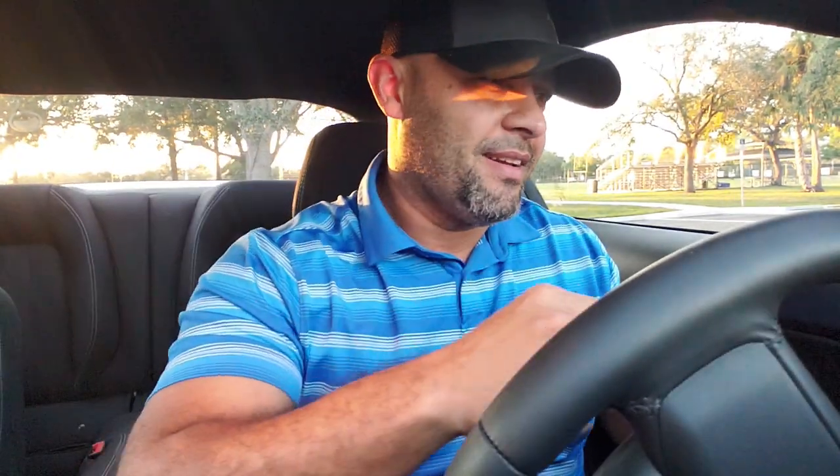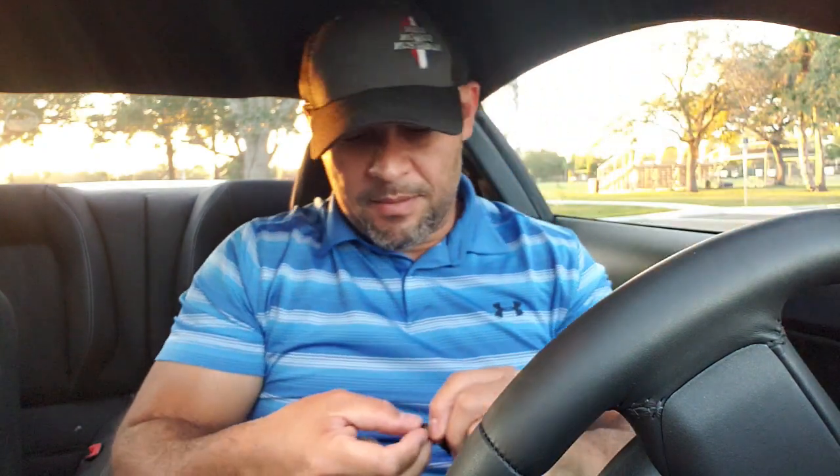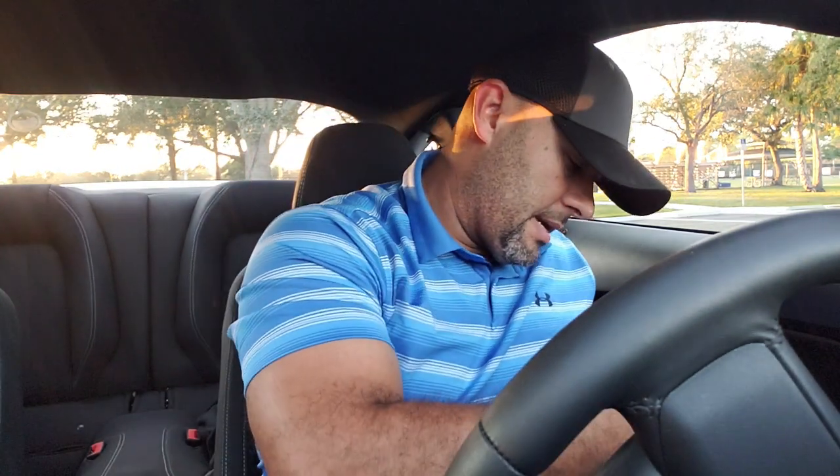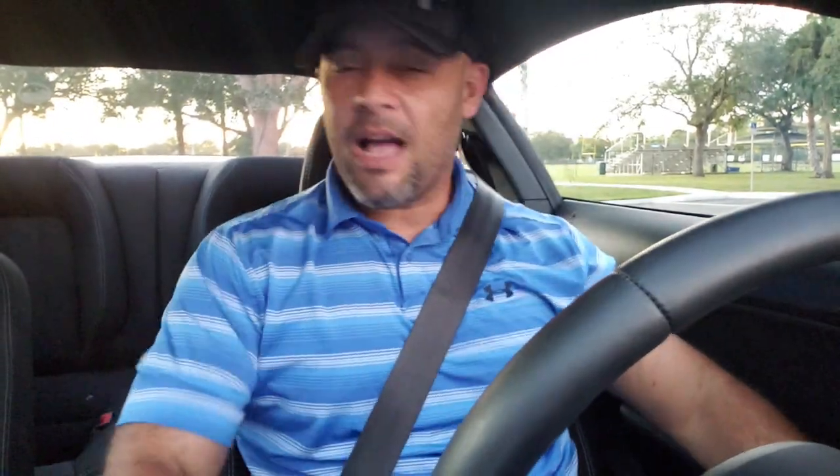I pulled off to the side. The car had learned 84.7%. I've got my laptop and an SD card adapter — I'm going to unclip the mini SD from the Engage, slide it into the adapter, put it in the laptop, and slap on the dedicated E85R tune to see how it feels. That took about 10 minutes. I'll stop talking for a bit — I know a lot of you just want to hear the car. I'm going to go back to the same street, get into it, lay into it, and see how much better the dedicated E85 tune feels over the flex fuel tune.